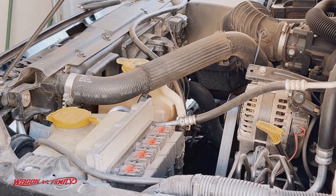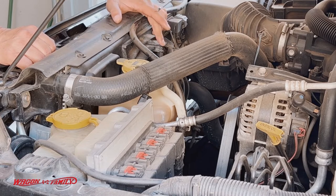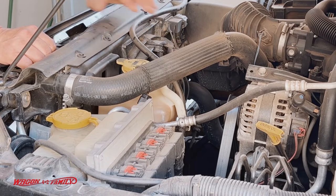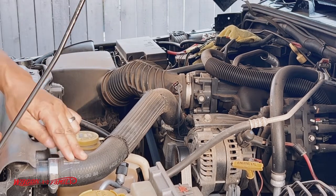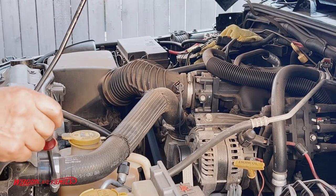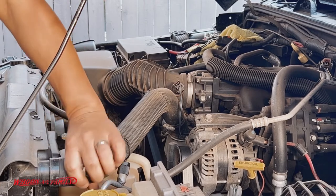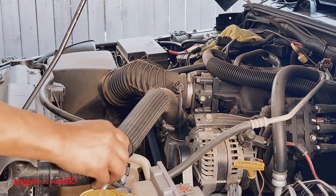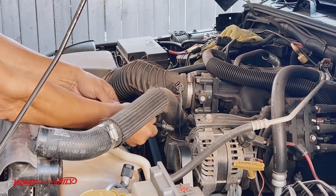There are a few things you've got to take off on the top side to get to the radiator. First, go ahead and disconnect the negative post on the battery because you are going to have to remove this fan and you don't want things kicking on and off while you're working. Put a towel under the battery terminal so it doesn't accidentally spark. Next we're going to remove the upper radiator hose, the reservoir, and then we'll need to remove this upper trim from the grill. Be mindful that when you take the upper and lower hose off you might get some fluid coming out, so make sure you've got a catch can or bucket down below.